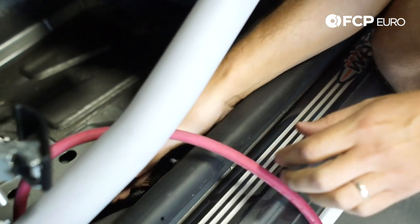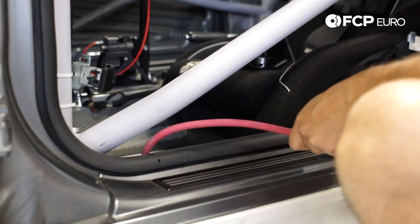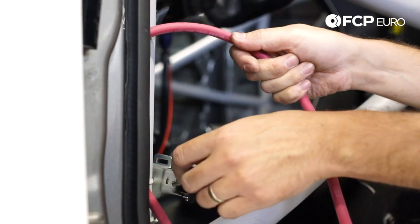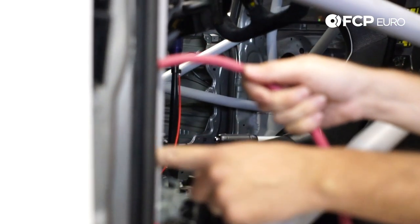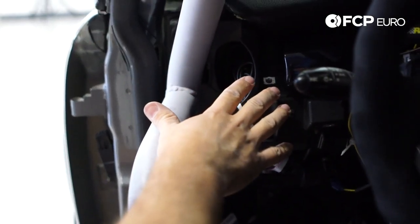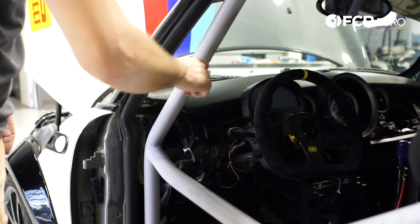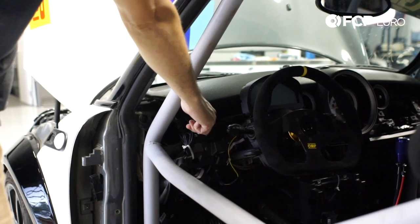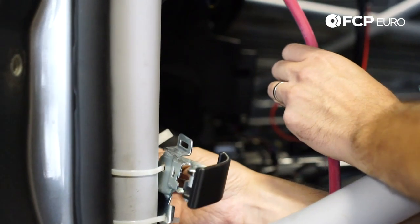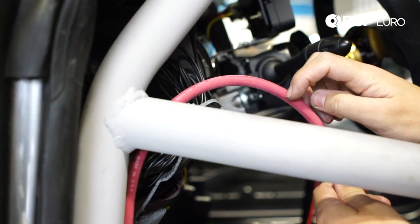In our case we're running a kill switch — but if we weren't, this would be the time we'd run the battery cable to the original location of the battery in the front of the car. If you're working on a drift car, race car, anything with a roll bar or roll cage, you want to make sure the cable passes on the inside of the cage. If you have the cable passing over the outside of the cage, that would be considered illegal and could possibly not pass tech inspection. We're going to mount the kill switch right here because it's accessible from the driver — the driver can reach forward and turn it off — and if a track worker needs to turn the car off, they can do so from the window. Now that I have the cable length run, I'm going to give myself just a little extra wiggle room and cut it right here.